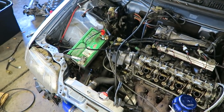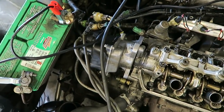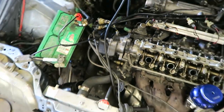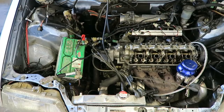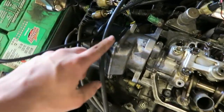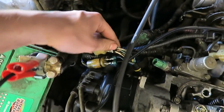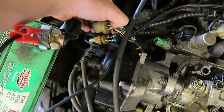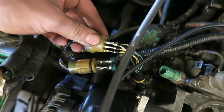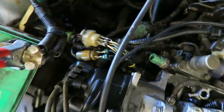There wasn't a video last night mainly because I didn't get a whole lot done. I was messing with the distributor for a bit because I did find one in our box of parts in the shed. I took my old coil out of the distributor I had that did work and put the coil in this one. Then I didn't have a conversion harness — this is an OBD1 distributor — to plug it into my OBD0 stock harness, so I just pulled all the pins out of the plug for the distributor and shoved all the pins into the stock harness, color-matching the wires. That should be good.